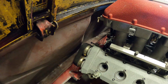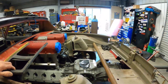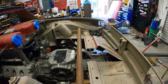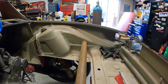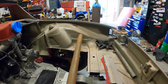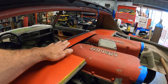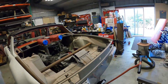With the clearance at the cam belts without the guards on them, I think I'm going to go ahead and tweak that firewall a little bit so I can move the motor forward just a tick. Partly because when I do that it'll allow me to get the transmission hanger directly under this tube. I'd really like to get it right about here — that's going to get plated to be stronger and tied in with the rest of the chassis. If I can scoot the whole drivetrain forward just a bit, I've got clearance up here to play with, and the pulleys and belts look like they'll be in okay shape too.